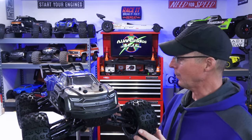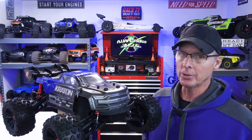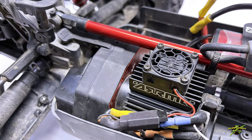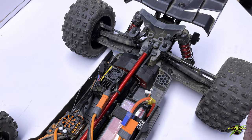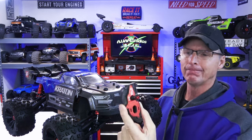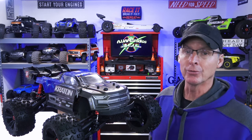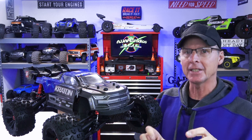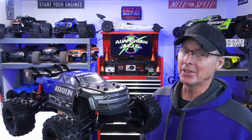The tests were successful — it went right in, everything functioned the way it was supposed to, and it's really slick. One note though: I would definitely swap out the fluids. The stock fluid that came in the differential was a little heavy and it caused a lot of wheels getting up in the air. If you're into that, great, put it in stock — but if you want a bit more control you might think about thinning that fluid down. I was really happy to get rid of the slipper clutch. These big ones need to have that independence between the front and the rear to get any kind of decent control out of your rig. It went right in nice and slick — for the first installation it took a little bit of finagling to click into place, but it goes with no modifications. That's awesome — it's in there and it works.